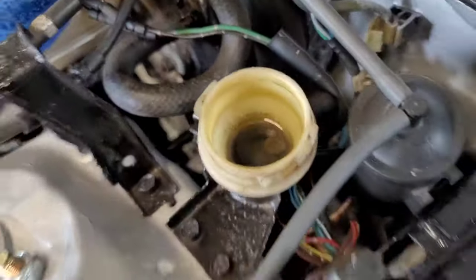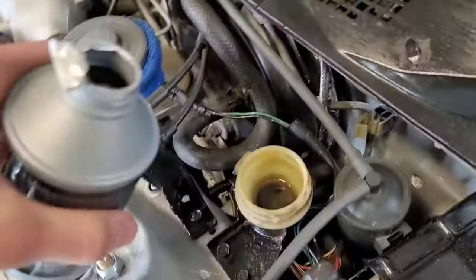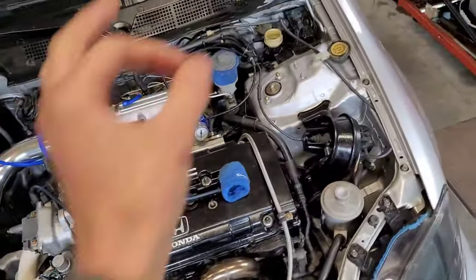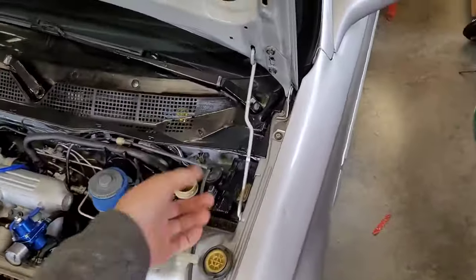You get fluid there after a few pumps — it's already gone down. So just grab your fluid, fill her up, come in the car and pump your pedal by hand. It literally just goes with the spring for now, slowly starting to feel pressure. It was dead empty, so you do that a few times, come out, check — reservoir's gone down, fluid's coming out, no leaks. Just do this until you have good pressure and the reservoir is full of fluid, and you're done.